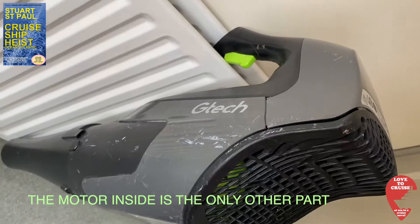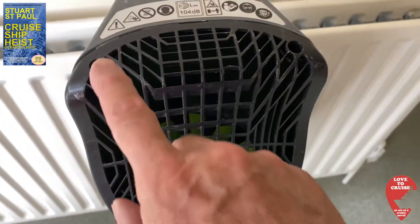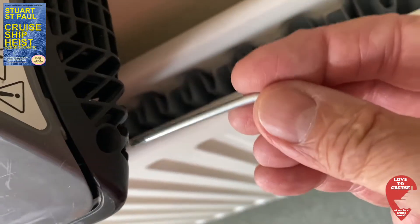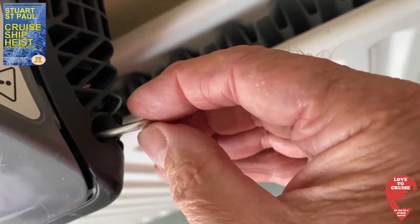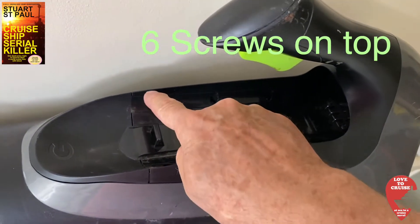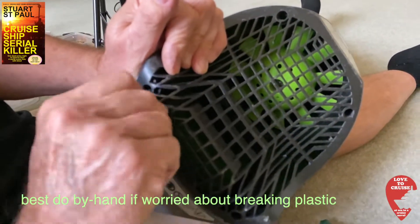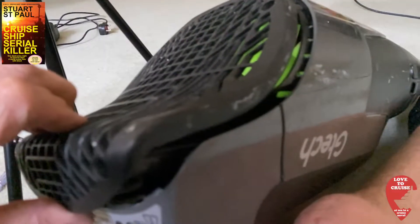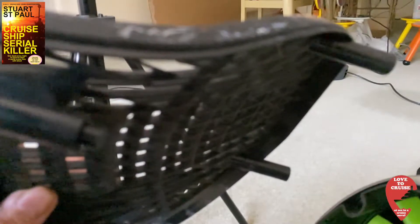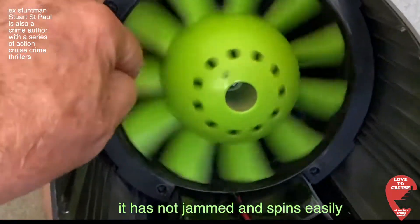Pull the trigger — it fires the battery but no leaf blower. The switch is working. So we're going to take this little baby apart. Essentially the back needs to come off and then the handle assembly. The battery is disconnected. We'll need to attack the screws with an allen key — a long allen key for the back because the holes are recessed. On top you could use the allen key or a weak electric screwdriver, but beware: electric screwdrivers have so much torque they could break the plastic. Lift the back away carefully, not to break the lugs — there are four lugs that stick out. These do break with vibration; I've only got three out of four still intact.